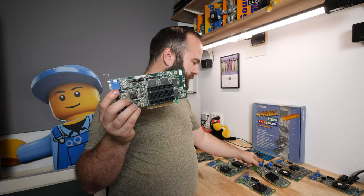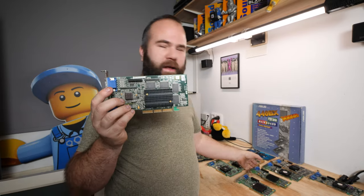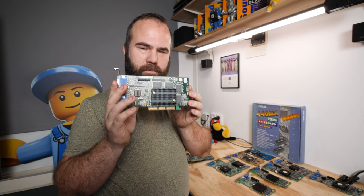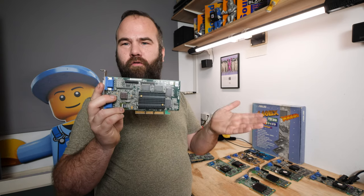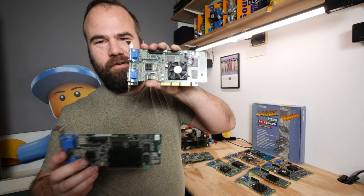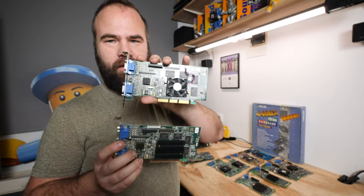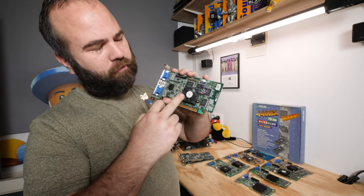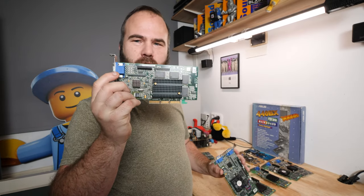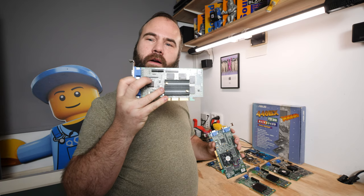The Matrox G400 is about the same speed as the Nvidia Riva TNT2, so back in the day this was an absolutely good performing card. I bought it for my own Pentium 3 450. There's also a better version — the Matrox G400 Max — which also has 32 megabytes of memory but is higher clocked, with maybe a bit higher memory speed and active cooling. If you can find the G400 Max, go for it, but the standard G400 is perfectly fine too. Passively cooled cards actually have a longer lifespan since there's no fan to wear out.